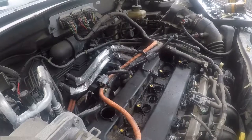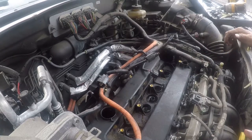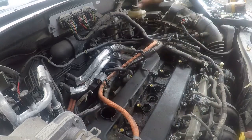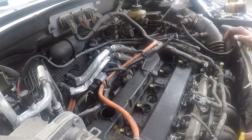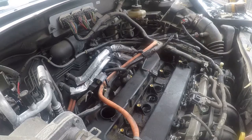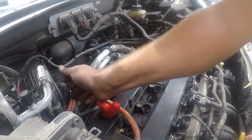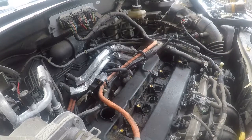They're all in. So I went ahead and decided to get the valve cover gasket and do this while I'm in here. So these unscrew. I just moved the wiring loom back, disconnected sensors, got things out of my way. And if yours has been in here for a long time, it's going to be hard to get off. So just take something like this and stick it in here and gently pry, and it'll pop it loose.